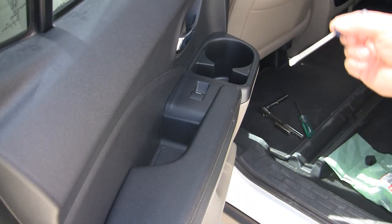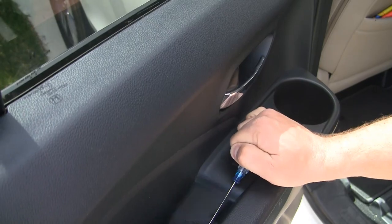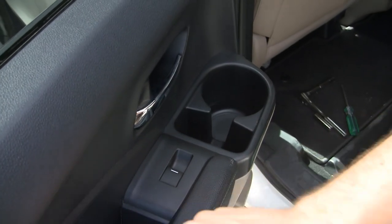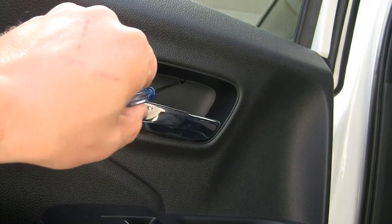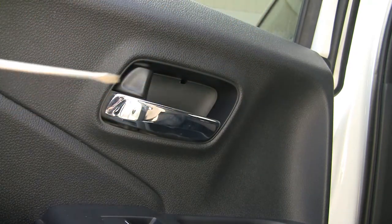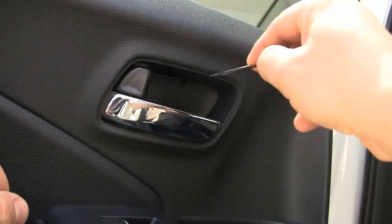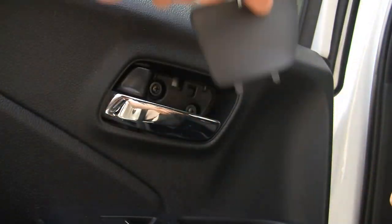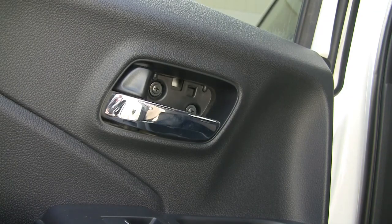With the left door open, we're going to start. See right here? There's a little panel there with a little pop. And then you'll see one little Phillips screw right in there. The next panel we've got to pop off — there's this little deal right here, stick it in there, and it'll just pop right out. There we go. And now you have access to the three bolts we need to take off, so we're going to go ahead and take those off.